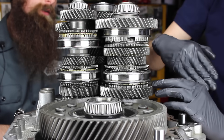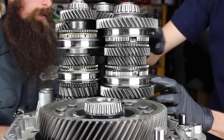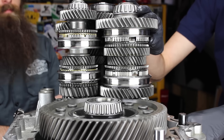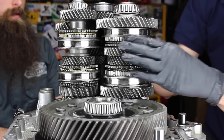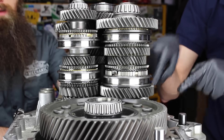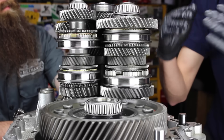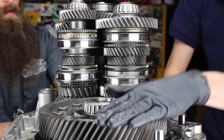If we engage first gear, this collar here will engage first gear and you're sending power to the wheels. Now, while you're doing this — as you're revving up to higher RPMs and the clutch is anticipating you shifting to second — the second gear collar will engage while the first gear is still engaged. But remember, the clutch that this second gear is engaged to is disengaged from the engine, whereas the first gear clutch is engaged. So once you actually shift gears, this will disconnect, and all the while your clutches are switching — this one will start receiving power while that one is still receiving power. You'll have this overlap where you're always going to be getting torque, decreasing from one and increasing to the other, sending power to the driven wheels through the differential.